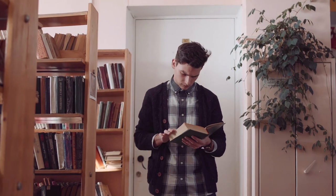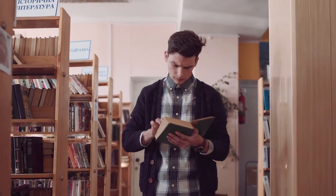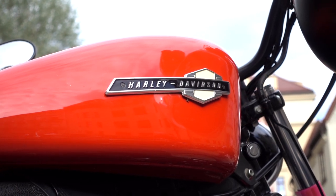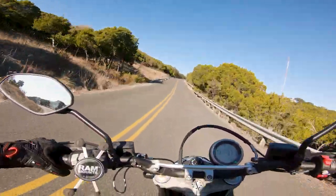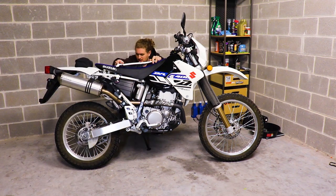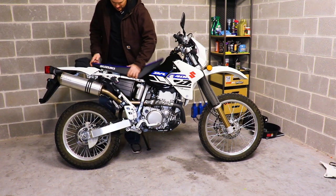Number 1: Research. The first few tips all take place before you even pick up a tool, and the first is simply to do some research. First understand what your bike is. If it's a sport bike, you'll probably need to take some fairings off — do you know how to do that? If it's a Harley, you might have a smattering of metric and SAE bolts because they built it with whatever they had on the factory floor, so you'll need both in your toolkit. How many oil drain plugs does your bike have? If you don't know the answer to these questions, you need to get on your computer and do some research. Start with YouTube videos — every single job I do, I first look for a video of someone else doing it. For example, I recently did the first oil change on my DRZ, and I didn't know that it had an internal hidden oil screen. I found a video and watched carefully for all the details of finding, cleaning, and reinstalling that screen before even lifting a wrench.